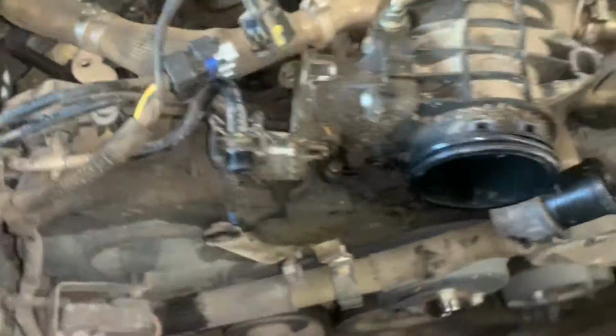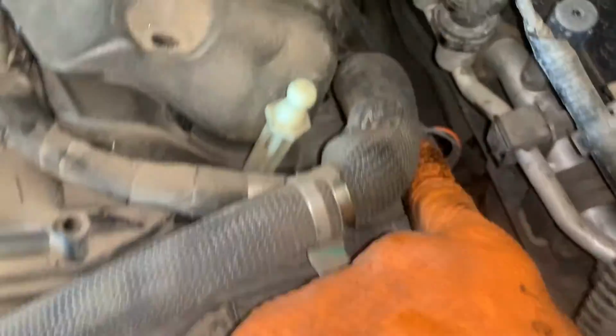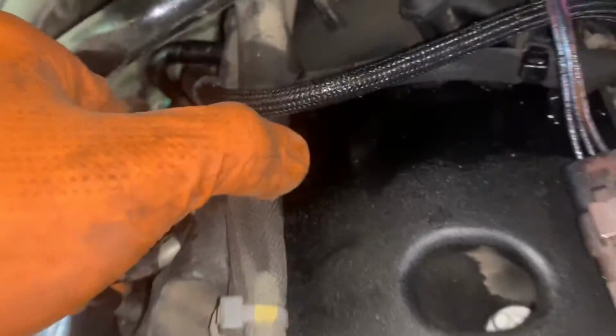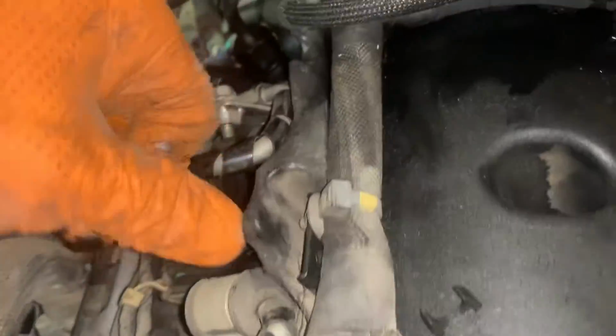As soon as we're doing the timing belt as well, we're going to have to take these off anyway, so we need to get as much of this off. So I'm going to come down here and undo the 2 8mm bolts this side, and this side down now. One's already out, so the other one's hiding in the cover. The split we're talking about, you can see the oil vapor here, is underneath this wiring loom. Very difficult to see where it's split.